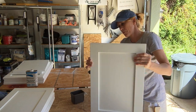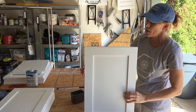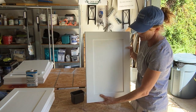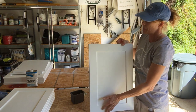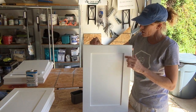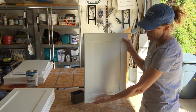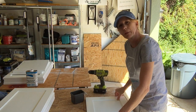Once you find your point of reference — this is the top of the cabinet — if this is going to be an upper cabinet, go ahead and drill your holes in the top, so that once this goes back up and you reinstall it, nobody will ever see the holes. If this is a bottom cabinet door that goes below the countertops, you want to flip it over and install your hooks on the bottom sides of the cabinet doors. That way, just like with the top, when they open and close, nobody will ever even know the holes are there.